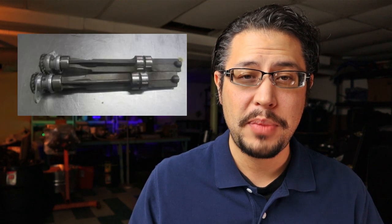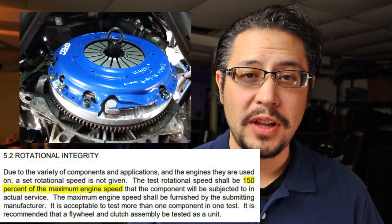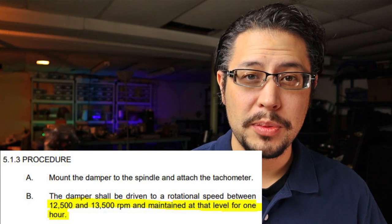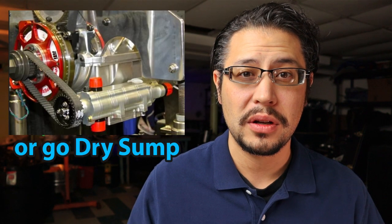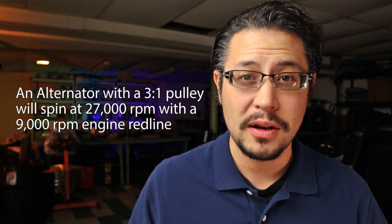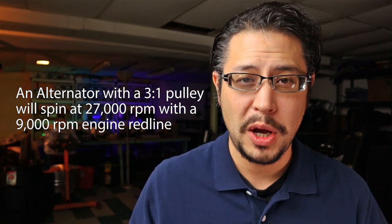You're going to need an upgraded crankshaft, upgraded rods, upgraded pistons. You'll probably need to blank out or remove the balance shafts. You'll need a certified flywheel and clutch, or flex plate and torque converter depending on whether you're running a manual or automatic transmission. You'll need an upgraded harmonic balancer — certified — and likely upgraded oil pump gears, something like billet, post-treated, hardened, or shot-peened so they don't explode. You'll also need to underdrive your accessories using smaller pulleys so the power steering pump and alternator don't spin past their limits.